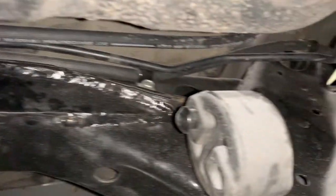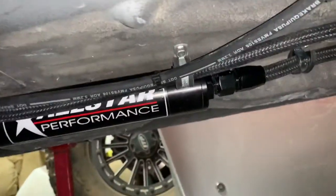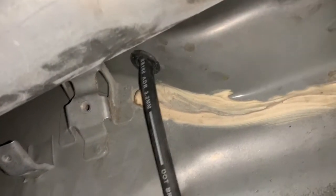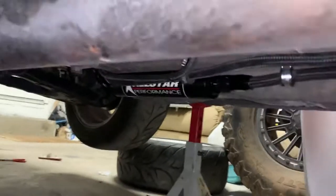If you bear with me, we'll go up underneath the car. I finally have the hydraulic handbrake line ran. It comes down right here and the fuel lines drop right in front of the factory gas tank right there. I have it secured with a 12 millimeter bolt right there. The lines go forward — we have the fuel filter right there, along with the handbrake line held on with a couple zip ties and bolted on right there. The handbrake line comes up to a little grommet inside the hole where the factory cable goes. And then we follow the lines all the way forward — lines go all the way up. It turned out really, really good. I'm about to tighten down all the lines so we can give this a test fire.